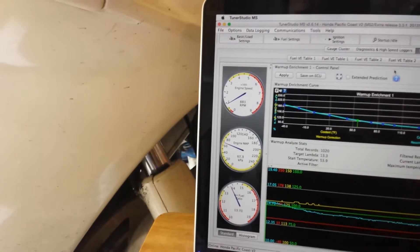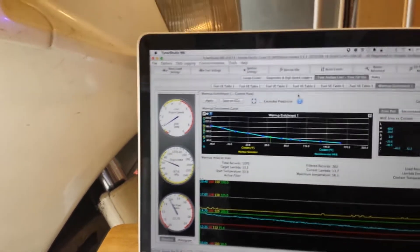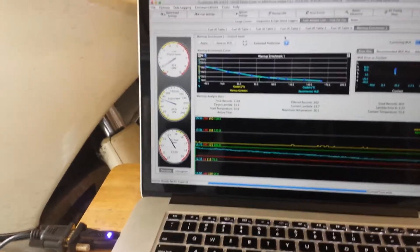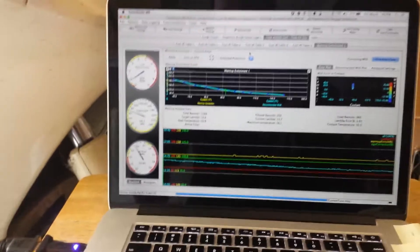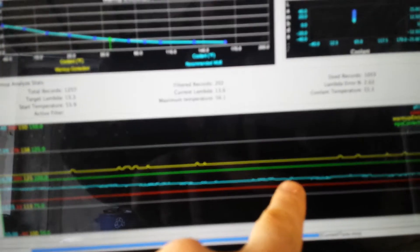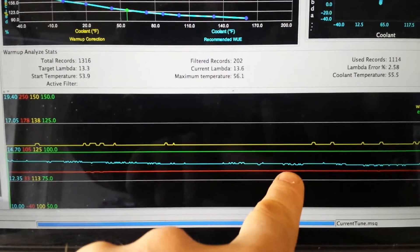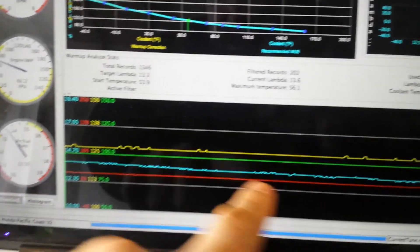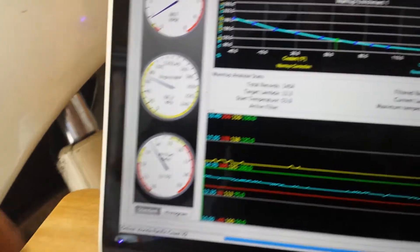You can see the engine's idling a little low. That's because I have the throttle all the way closed. The throttle's set to be closed and idle at 1100 RPM when the engine's warm; when it's not, it idles a little slower. The blue line is air fuel ratio, which looks like it's running at 13.5 right now. So just a little bit rich, but that's fine when it's cold.